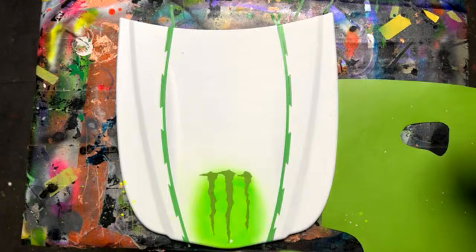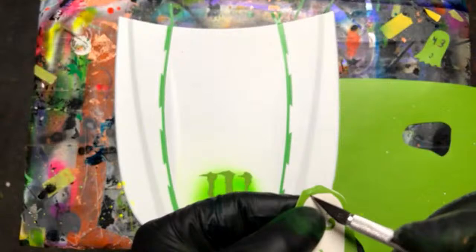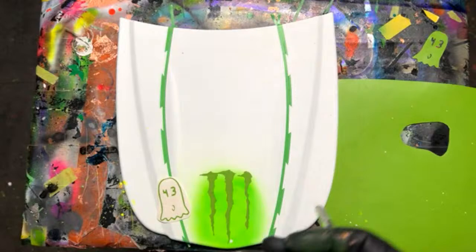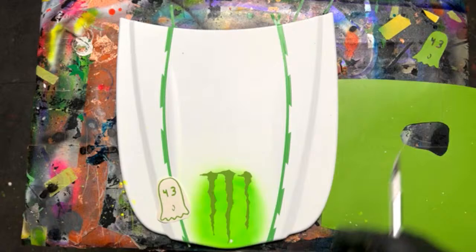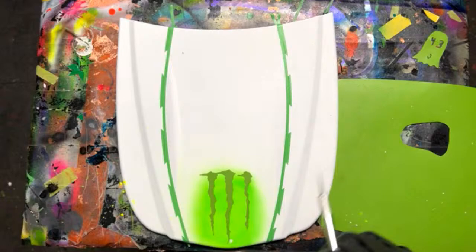Let's see here. Make sure I'm doing that right. Someone asked, how long do you wait for the glue on the copper leaf before you engine turn it? What's the window time? You don't have to wait. In fact, you should do it right after, with the Limeline glue. No wait time. He's talking about once the copper leaf is down, you've got all your edges down nice and smooth and it's all brushed out. It's good to spin right after that. That's when you should spin it.